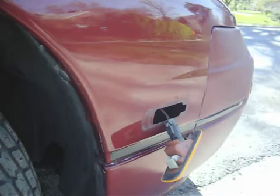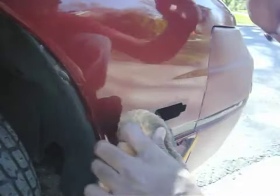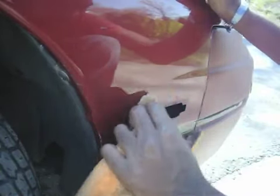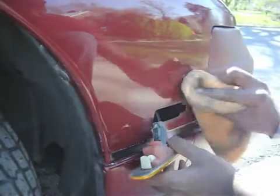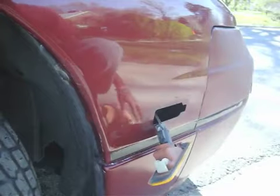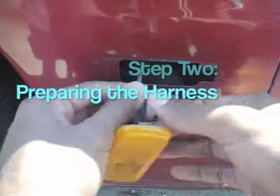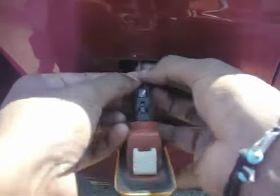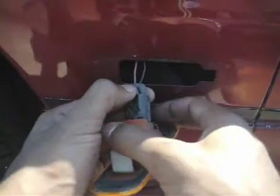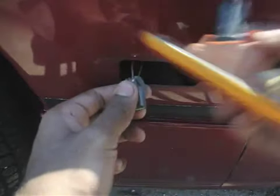Just be careful about this front clip and the back clip, and also be careful not to scratch your paint. If you're OCD about your car like I am, now's a good time to clean up behind this side marker because most of the time you're not going to take these off to wash your car. After that's all cleaned up, when you pull this light out, you're going to see two wires. Go ahead and unplug your side marker for now and put that aside so nothing breaks.